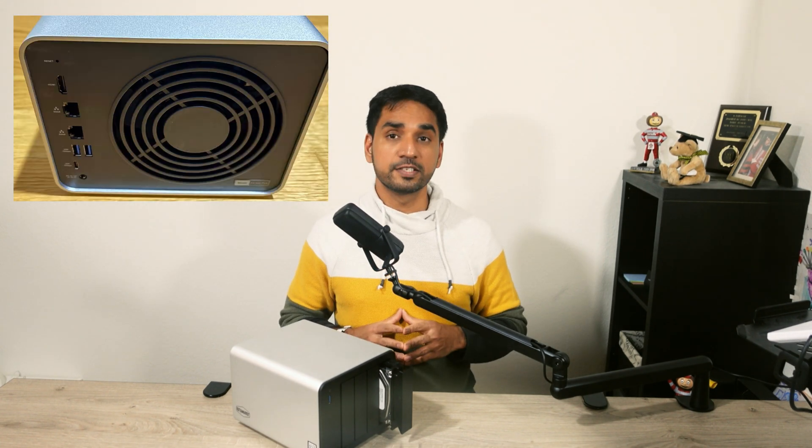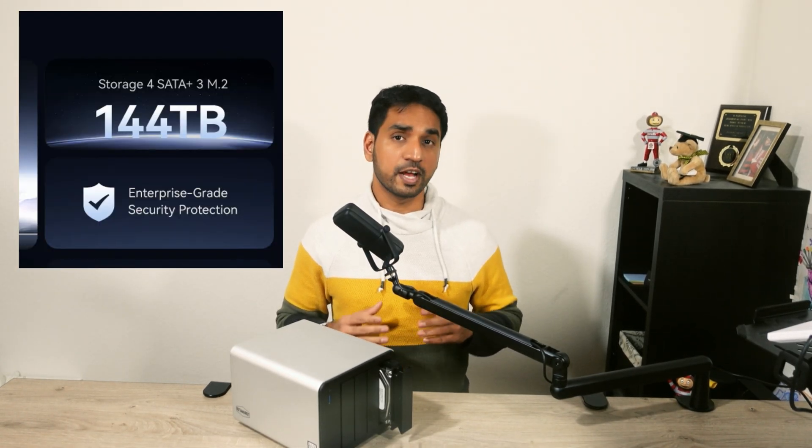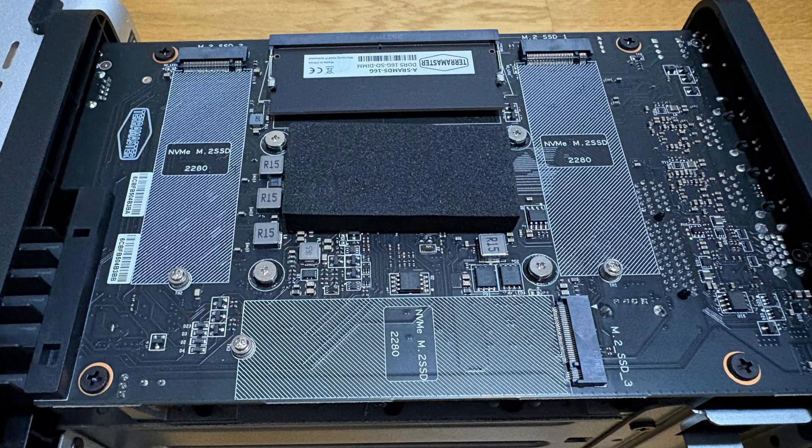For connectivity, you get two 5 Gbps Ethernet ports on the rear. This is highly unusual and a significant step up, as the 5 Gbps transmission speed is twice that of the common 2.5 Gbps standard found on competitors. These ports support link aggregation as well, potentially offering up to 10 Gbps of bandwidth. The four 3.5-inch drive bays can take drives of up to 30 TB for a whopping 120 TB of storage. They can also fit 2.5-inch drives with an adapter. The F4-425 Plus also has not the normal two, but three M.2 SSD slots, which can be used as a storage volume or SSD cache in any combination.